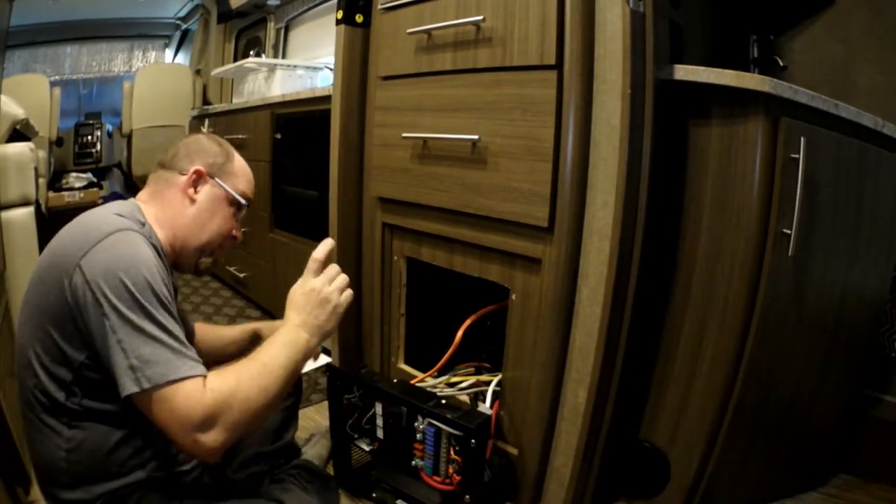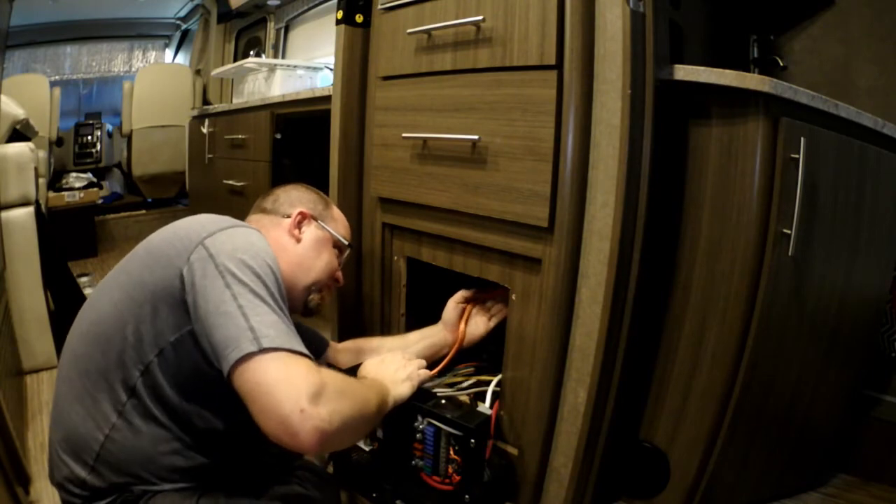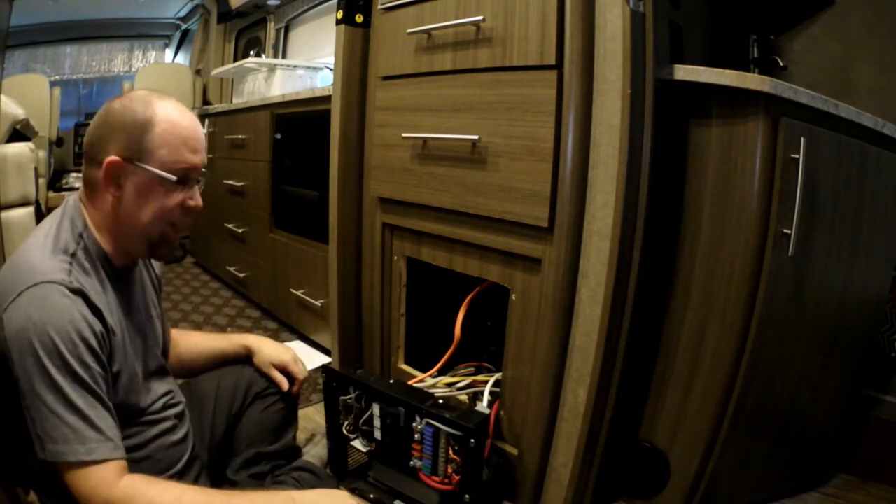I'm going to put the camera back inside so you can see what's going on, then go outside and plug the shore power in and see what we get. If I'm reading the instructions correctly, it has a startup delay — the line light will be green, the delay indicator will be flashing when you plug it in. Once the caution light stops flashing it takes 128 seconds, then verify RV power is on. That was exactly correct — it takes roughly two minutes to go through its test cycles and power up.